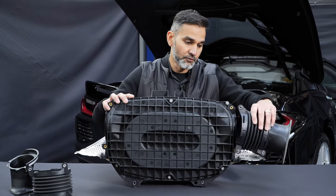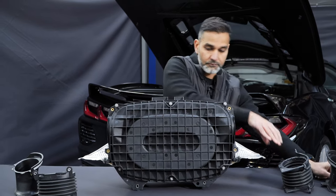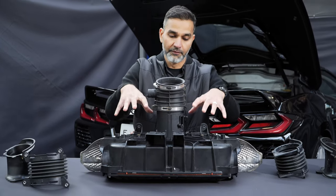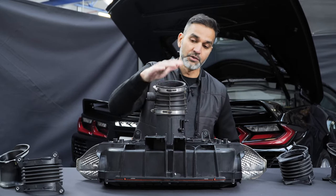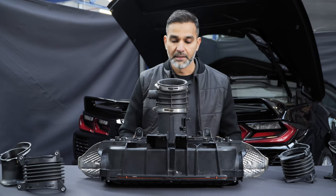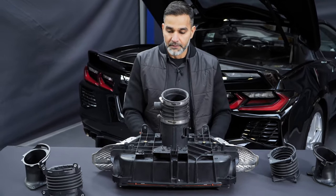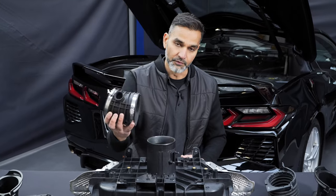These flexible hoses are important to allow some movement on both sides. Turning the airbox over, you can see how the airflow moves from the filter through the MAF tube and into the rubber hose which connects directly to the throttle body. The MAF sensor sits in this square slot, and there's a very sharp 90-degree bend between the opening in the airbox and the MAF tube itself. That's your final connection, with the breather port on one side for the breather recirculation system.